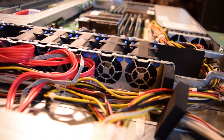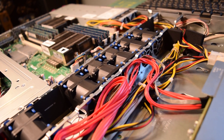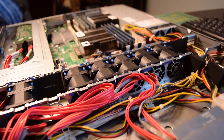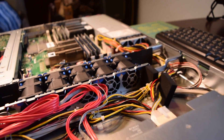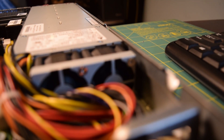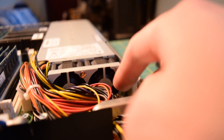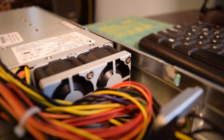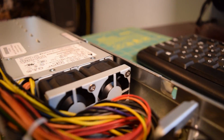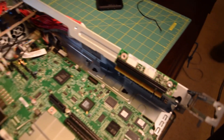That sounds beautiful and terrifying at the same time. Here you can see our dead power supply fan. Moving the camera in to focus — you can see that this one is clearly moving, but this one is stationary. I'll give it a push and it should start moving. There we go — I got that one moving, and it's grinding the sidewall because the bearing is all messed up. You can see how slowly it's moving — it's barely chugging along.